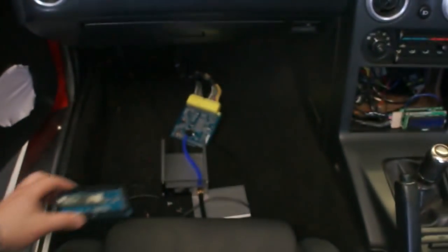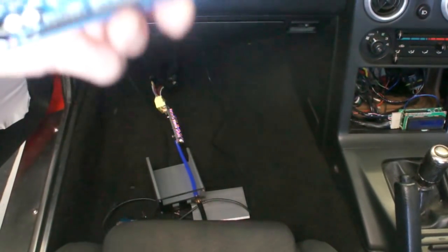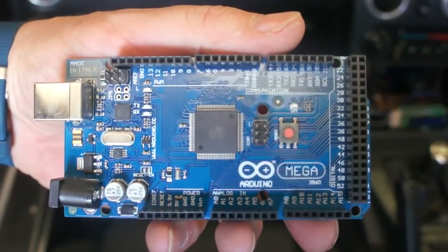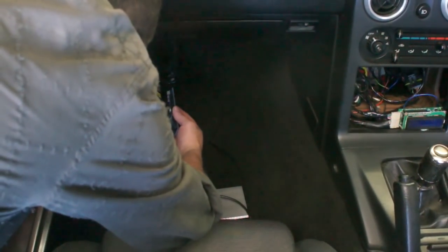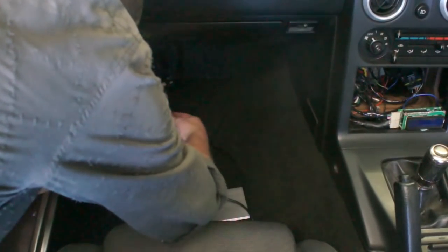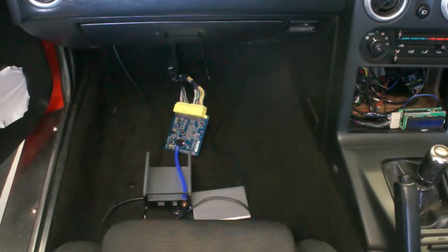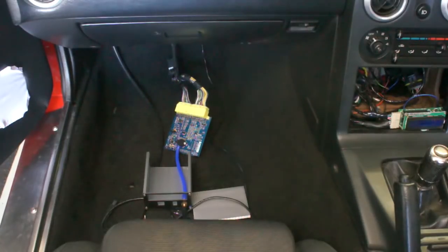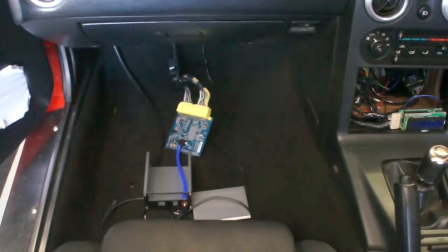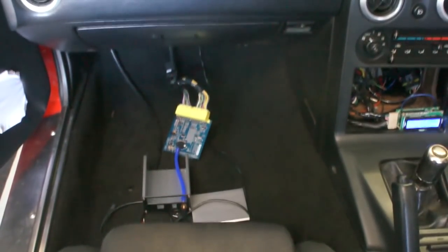What we can do is remove the board that's on there, which is a standard 16 megahertz AVR Mega board, and we can add this one. So exactly the same hardware, exactly the same tune, exactly the same firmware base — just a different board. Now running an ARM core at 120 megahertz. And we're up and running to an idle on that board as well.